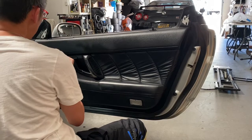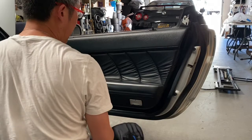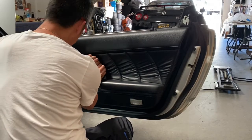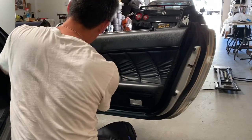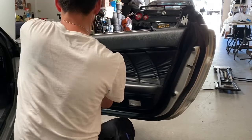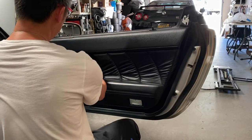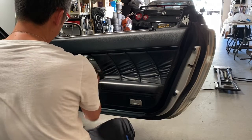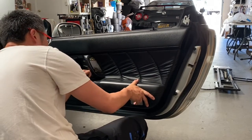This front piece also has three clips. Make sure you don't lose the clips. The next piece is the little trim piece in the door — reach your hand back there, use a trim removal tool, and pull it out with a motion of out and up. That'll reveal the door handle. Set this piece aside. There are black screws and gold screws here, some with spacers — they're specific, so take a picture if you can't remember which goes where.